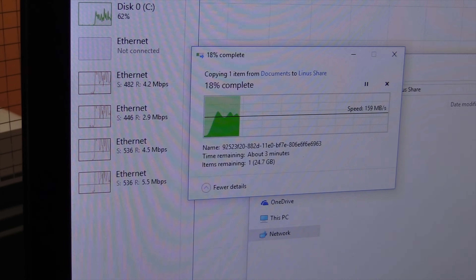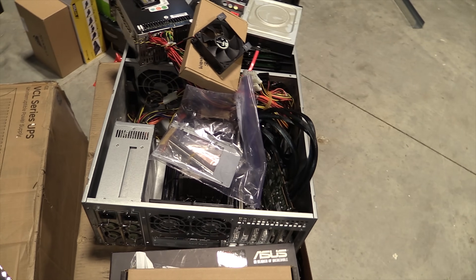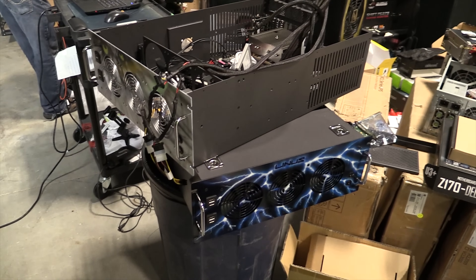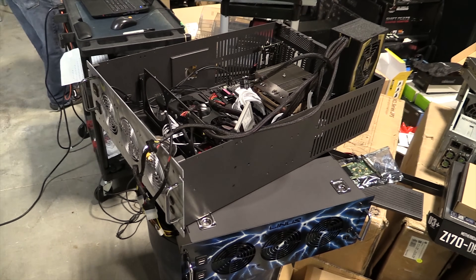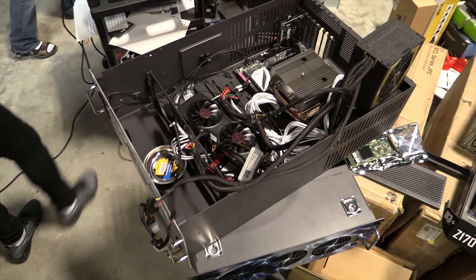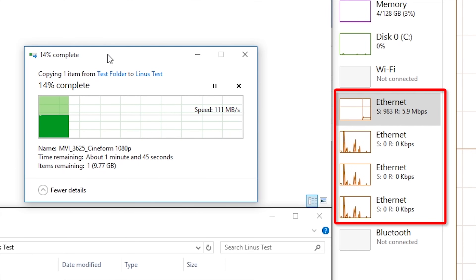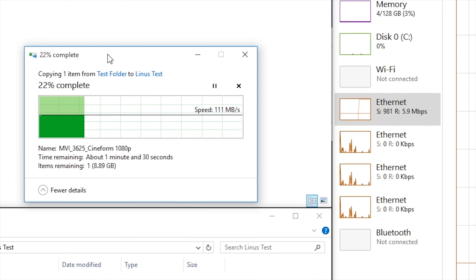This should have been capable of over 400 megabytes per second. So we started trying a lot of other random stuff — booting the Lenovo hard drive off my 8-core machine, trying fresh installs with Johnny's Windows 10 ISO — and in either of those situations, the multi-channel transfers we wanted didn't work at all. Both of us were tearing our hair out. Getting SMB multi-channel to work seems to be as much about luck as anything else, with certain hardware and Windows install combinations working while others weren't.